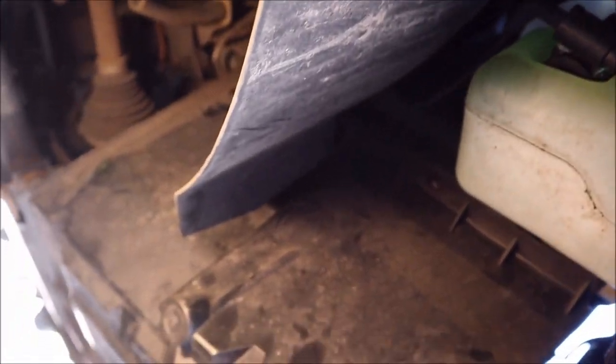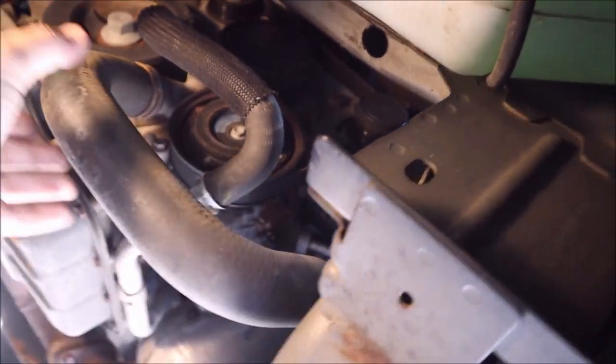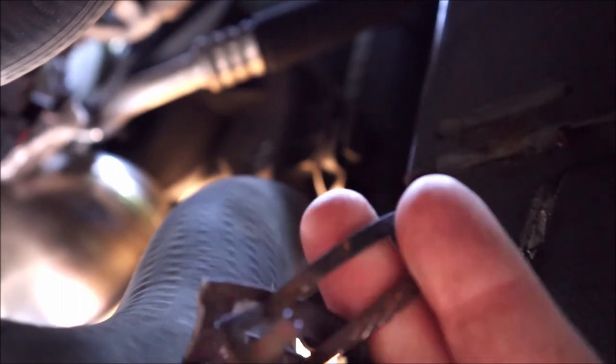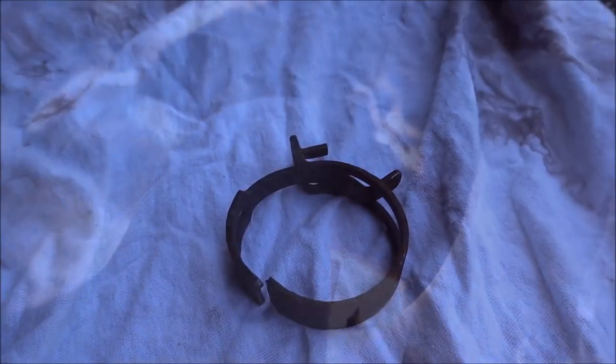There's a large shroud here — I've already loosened it up. Make sure you have good lighting under here, it will help. I've already taken off the hose clamp, and I'll show you what the issue was: the hose clamp had broken into two pieces. It's a spring clamp that applies constant pressure to the rubber hose, and it had cracked — maybe a manufacturer's defect — and that caused the leak. This pipe is loose right now and was dripping out quite a bit.